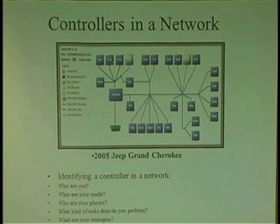So I tried to help him out. I'm like, dude, you pulled out the wrong computer. Over here is the BCM. Up here is the ECM. The BCM is pink connectors. The ECM has the blue and the red. So he pulled out the wrong computer.